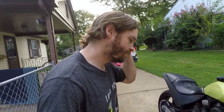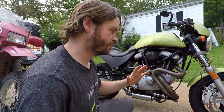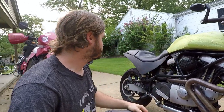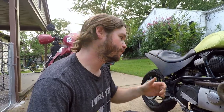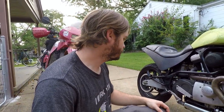But anyway, first shakedown, I think I got the head bearings a little too tight. Just feels a little awkward, but I didn't really check it when it was on the ground. I just tightened it up and just hoped that it was going to be good, but I know they're tight for now. I put my taillight on backwards, or upside down I should say, so my right blinker was my left blinker and left right. So anyway, gotta just undo that, flip it over, and yeah, we're gonna get there though.